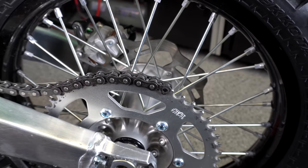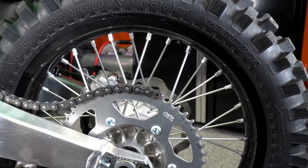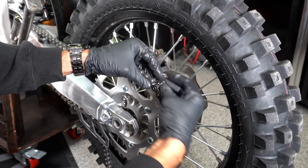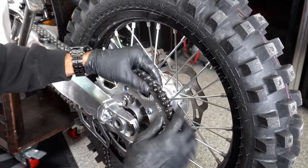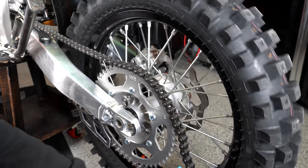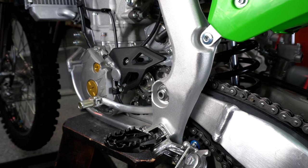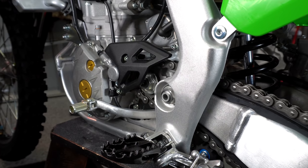The idea is I can use my old chain to pull my new chain up and around the front sprocket and bring it down all the way back easily just by clipping onto it. Here's my old chain on the left and my new chain on the right. I'm going to use my old master link temporarily — stick it right through here — and then just pull on the bottom of the old chain. It pulls my chain around and it goes right up through the front sprocket and down through the other side. It just really helps you to route this easily.